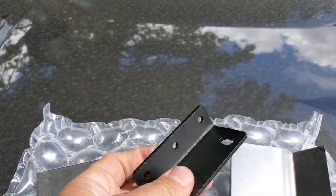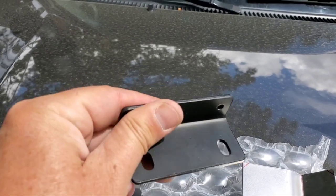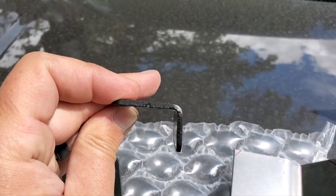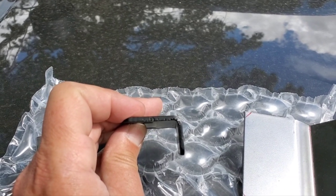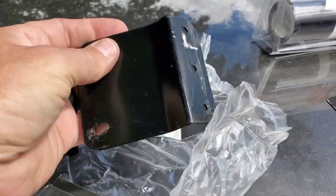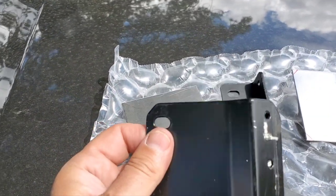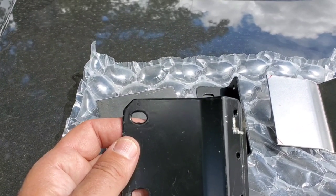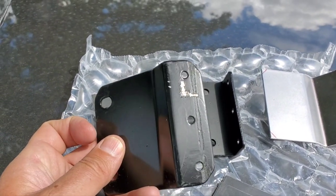The bracket that comes with the Land Cruiser 100 has holes for drilling into the pillar, which I did not replicate in mine. The stock bracket is also a 90-degree piece that's a little too thick for going between the gasket and our A-pillar, which can cause water issues and problems over time. I initially tried 0.090 aluminum cut to three and a quarter inches wide to fit into the slot — though measurements may vary depending on your snorkel brand.